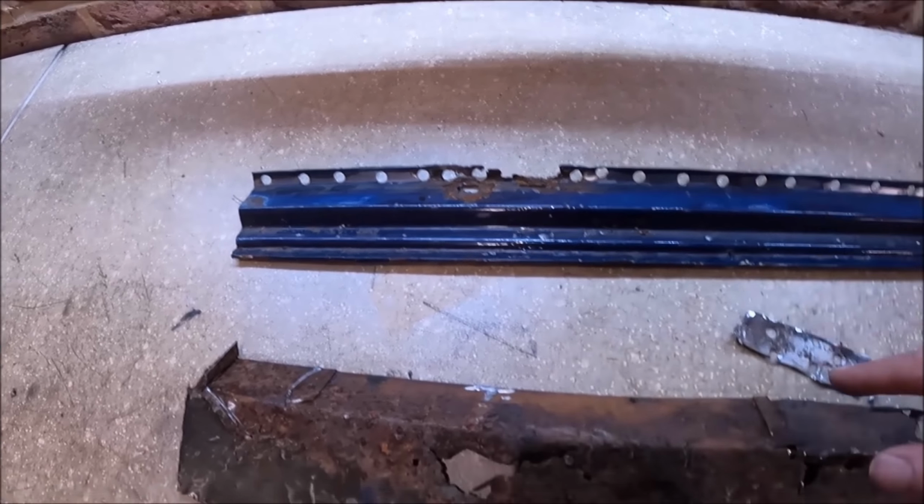I've actually managed to make use of the sling bracket bolt hole at the back there to align things on the back. And then I've welded the jacking point in, I've done my plug welds, I've seam welded along the bottom there, I've plug welded along the back here because I can't get to them with a spot welder, and I've left the spot welds, the top seam, and these bits until after. There is method in my madness, I think it's easier to do it that way.